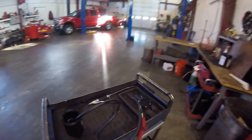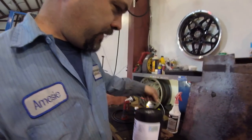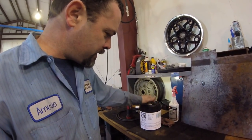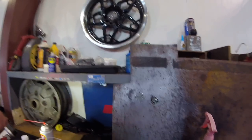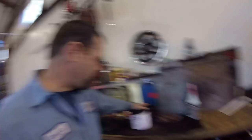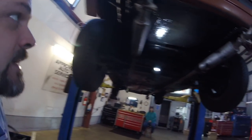This stuff also acts as a really decent lubricant — it's really safe for most rubber and plastics on late model and old cars like this. It gets into suspension pieces and acts as a lubricant, so if you've got any squeaks in your suspension, chances are this stuff will quiet it down and stop rust. Simple sprayer — you don't need expensive equipment to lay down stuff like this. I did that whole car with only about half a quart of the black, which means I have a whole gallon of the clear that we have to find another car to use on. I'm sure a rusty vehicle will come through the doors. New Hampshire oil undercoating — first time I've ever used it on the Sonnet, and I've used a few other types. Pretty pleasant to put on, cleans up off your hands pretty well, goes on nice and thick.